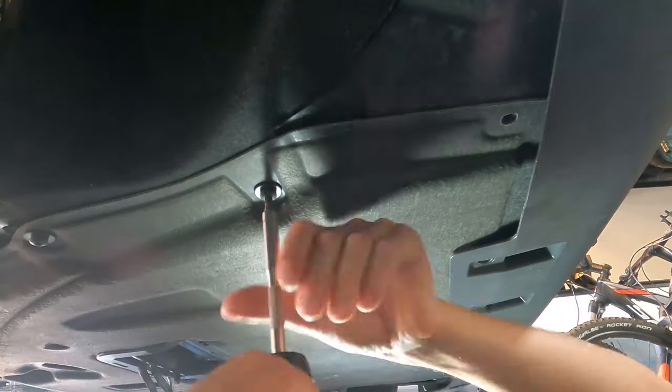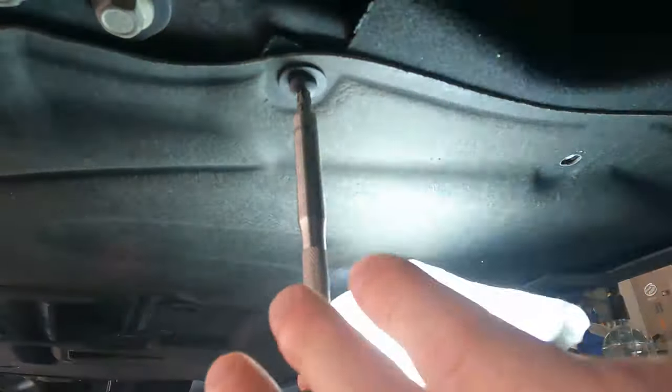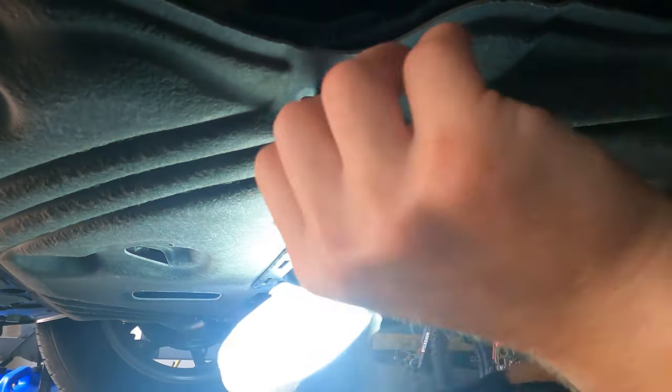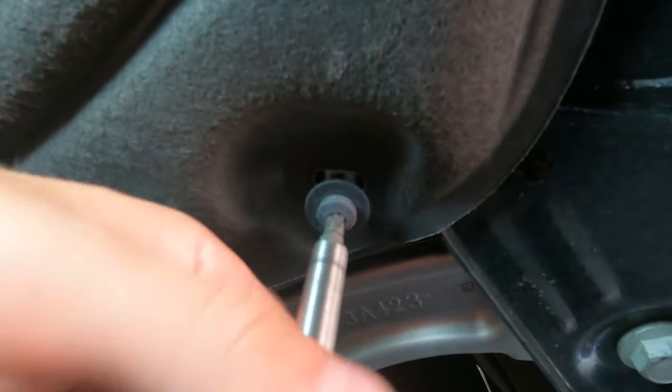And not only that, there are these little clips too, which need to be taken off. I use a flathead screwdriver to do that. Then you could just work your way around the shroud, getting off the rest of the T30 Torx screws. You see I dropped my camera there, but no worries. And let's see, I think if I'm not mistaken, there's about 10 screws to take down.